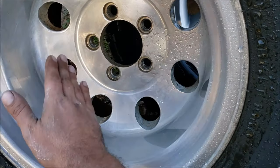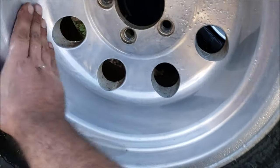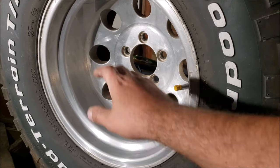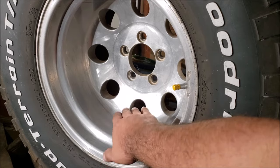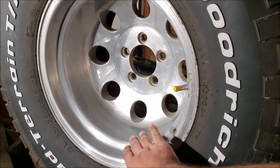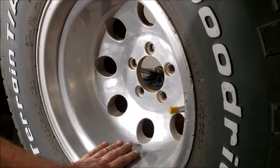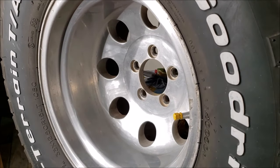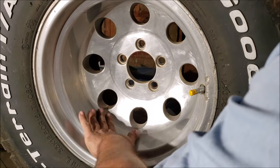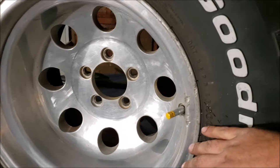You're gonna spend about five or ten minutes — you need to get all that roughness out, to where you run your hand down and you don't feel any grit or anything nasty. Polishing these wheels is not something you do all the time; this is an in-depth real polish that's gonna last another 20 years. These are the American-made American Racing AR 172s. The best way is one wheel at a time — take them off the car, use a waist-high table, and you need good lighting.